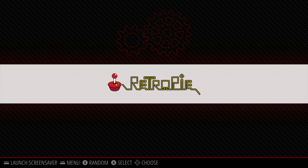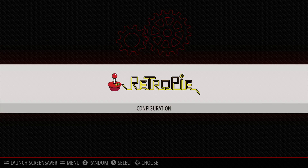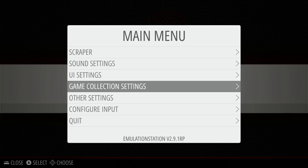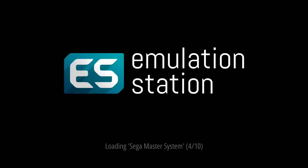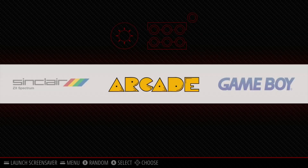You can see there are no ROMs in here — it's a first boot and I didn't put my USB stick in because my other USB stick was in there, the one containing the RetroPie image. So I'm going to plug in my USB stick now. The only thing about the Pi is there's not a lot of room in those USB sockets — it's a bit tight. Now if I hit Start and quit and then restart Emulation Station, you can see it's added all the ROMs that are on my stick.